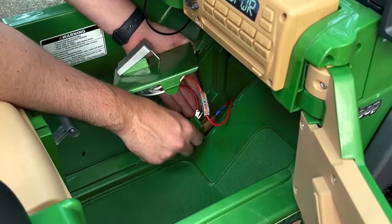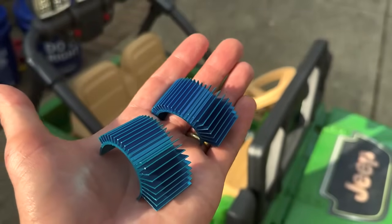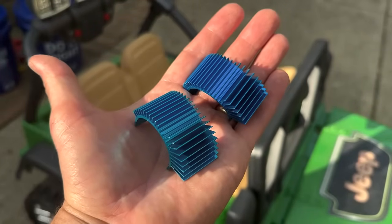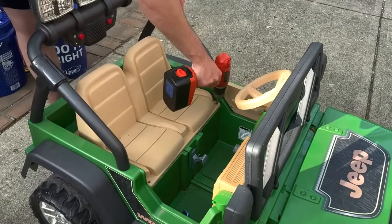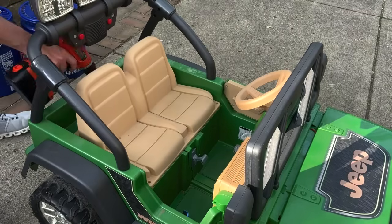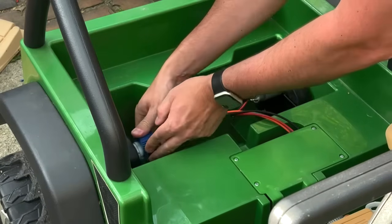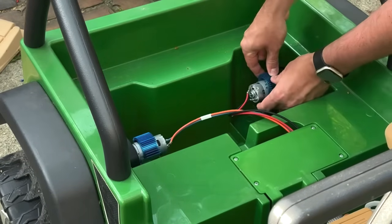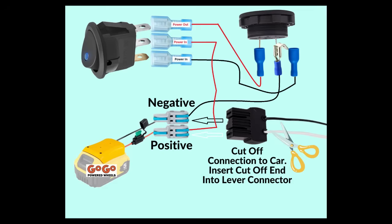Make the connection with the small spade connectors on both sides of the resistor, and then you're done. The kit also comes with two heat sinks — put these on the motors to help them last longer. You can find the link to my Amazon kit in the description of this video. If this video was helpful, please leave a comment letting me know, and if you have any questions, you can email me or leave a comment below.